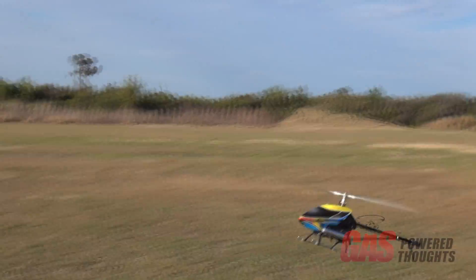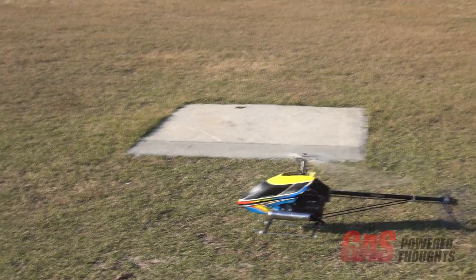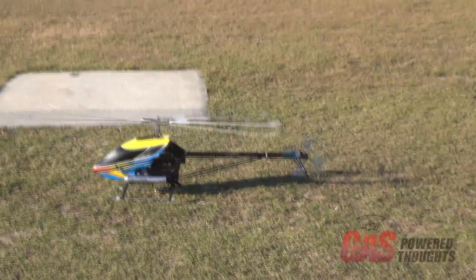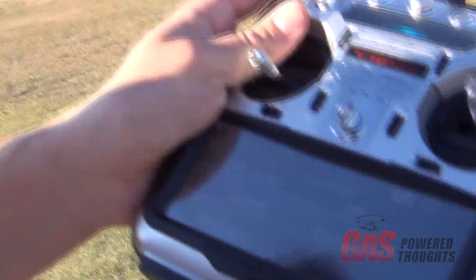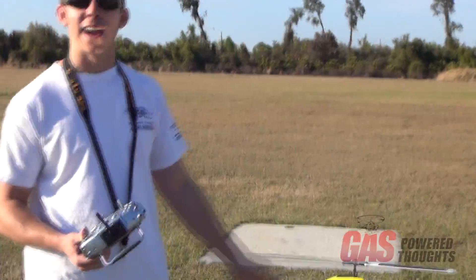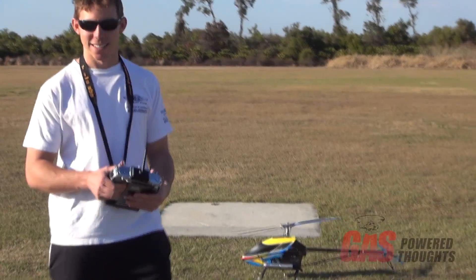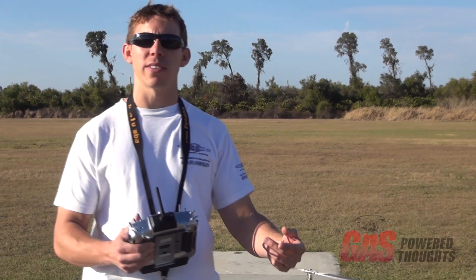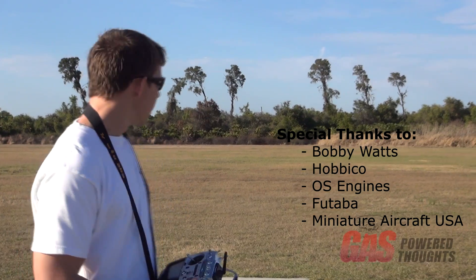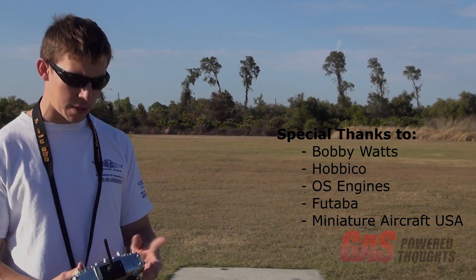For sport flying, I definitely think that this has enough power — even just mild to heavy 3D, it really did quite well. Let's see the temperature here on our display: 150, 147 after the flight. That's not bad at all for a decent 3D flight. And we can fly all day for, I don't know, $2 or something. He's running a 25-to-1 oil-mix ratio, synthetic — just put gas in and go. So this one's fun. This is the OS GT15HZ with the power boost pipe. Check it out.